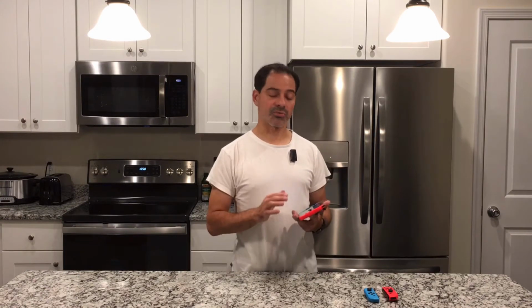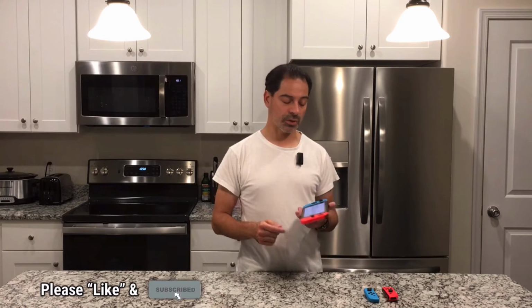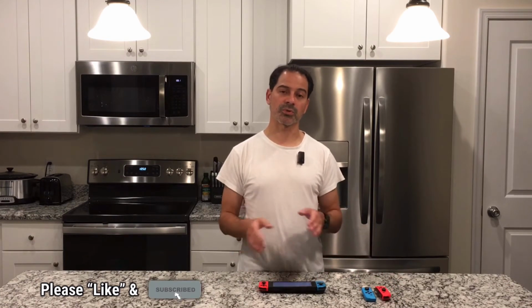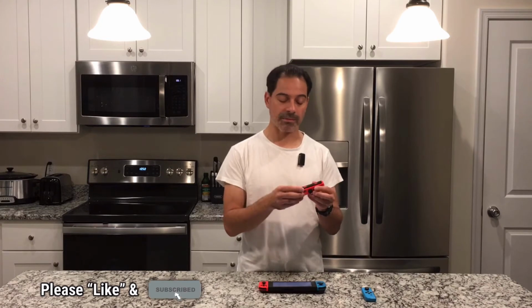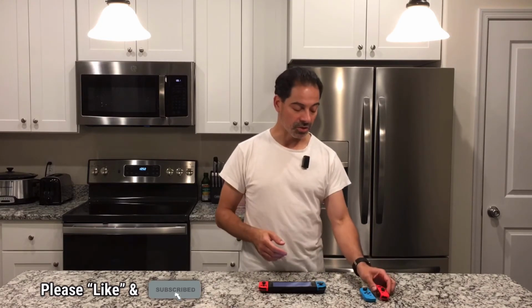Okay, well that pretty much wraps up this video on how to fix a damaged and non-working controller on a Nintendo Switch. In this case, we were fortunate because I had some extra components. We were able to open it up, diagnose the problem, which was a crimped and broken connection on the ribbon cable. And fortunately, on the extra one we had that was broken with something else damaged, that particular component was fine. We were able to combine them. So it always helps to have some extra parts around. If not, you can order those parts.